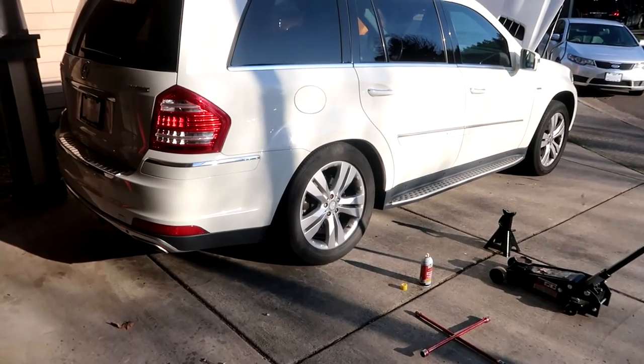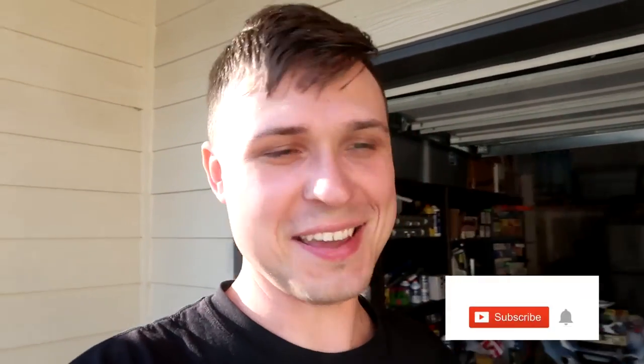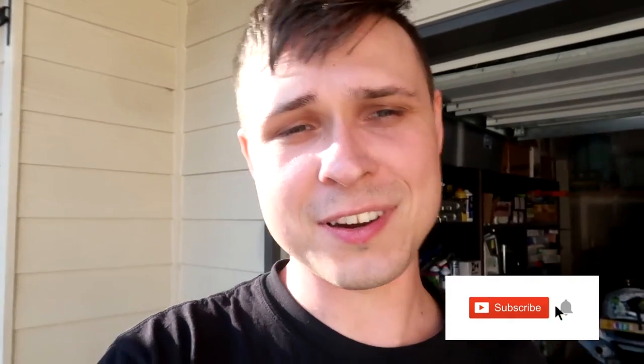There we have it — it is definitely starting to raise up. Not a very difficult job. I'm going to kill the car so it doesn't raise fully because we're going to do the other side anyway, and just let the compressor do both sides once we're fully done. That's how you replace an airbag suspension component. He did most of the work but it's not a very difficult job — just a little difficult to get to. It doesn't require a lot of tools, and two new airbags were like 66 bucks.